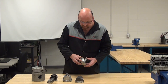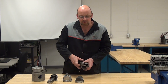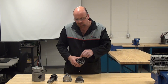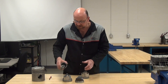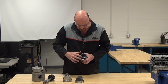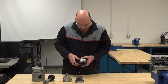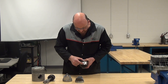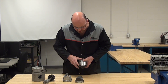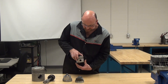The next one is a standard duty trunk style piston. It uses retaining clips to hold the piston pin in. The piston pin is fairly tight going in and then floats on the connecting rod. It has a large, long type of trunk to it, and a bit of a slipper skirt with an extension to help provide more skirt length, which reduces tipping in the cylinder.